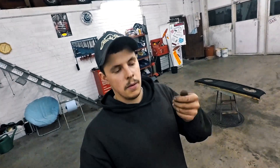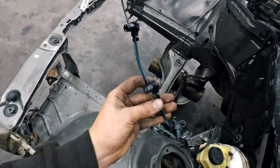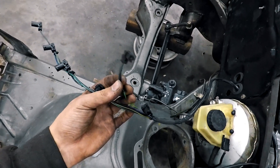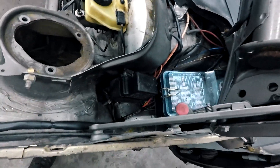All the electronics are almost sorted out. I made a new harness for the glow plugs to the relay using the original one from the OM605 engine. Sometimes you have to check the cables, bend them a little, and look if the plastic is hard — they usually crack and fall apart on these C-model cars. So I made a new harness, measured so they all have the right distance. The connector for the temp sensor is in the same harness. The relay is now mounted to the chassis and all cables are done. I only have to make some vacuum hoses for the key so the engine stops at the key.